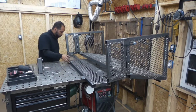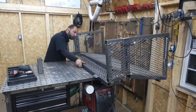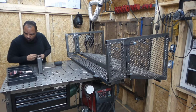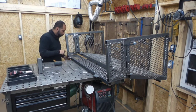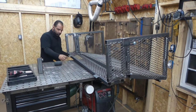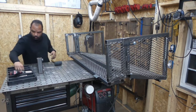On this particular one I just tacked on the tabs that would rest on your truck bed, but once I did the video I took them off — those tabs will not be on an angle, they'll be flat, because this section of the ramp is designed to be flat. There'll be four bolts — just put them on and get the nuts started, but don't crank them down yet so you can line everything up before tightening.